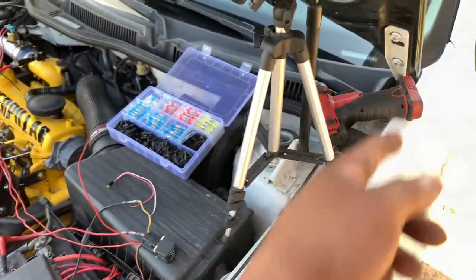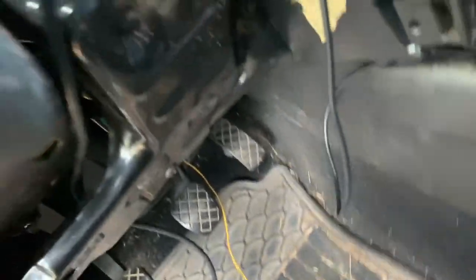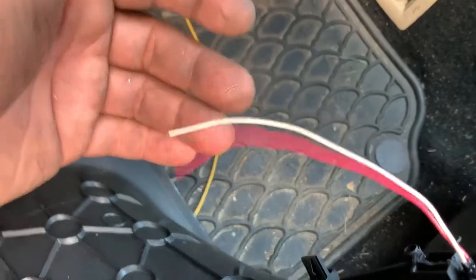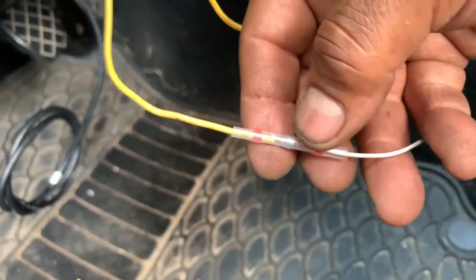Now I want to wire the indicator light to the dash - I'm inside the car. I already located where I'm going to install it. Make sure you glue it if the hole is a little too big, like mine was. That yellow wire is the signal - at the same time the pump sees power, this wire will see power too. It'll be in this corner and I only need to ground it. To make this LED last longer, I added a couple of resistors on the power line so it doesn't receive too much power and blow the light out.